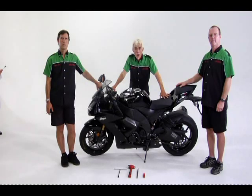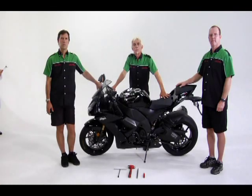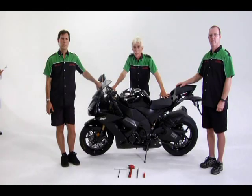We can vary the feel and handling of the bike by changing the spring preload towards a softer or harder setting. Preload means capturing a spring and compressing it to less than its free extended length. The more preload you put on the spring, the stiffer it will feel. Fortunately, there are guidelines and simple adjustments we can make to customize our spring settings to conditions and rider preferences for handling and feel. We call this SAG adjustment.